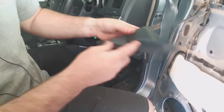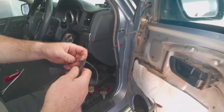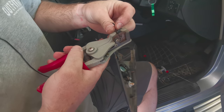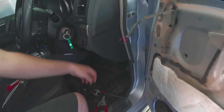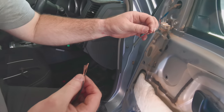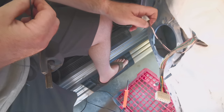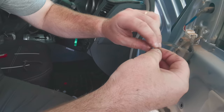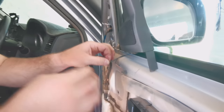So all you gotta do is just wire him straight in and that's your tweeter. So then we've just gotta cut him onto that and we'll splice him into there. So we'll trim this off about there. Hopefully I can, yep, that's good. Goodbye factory wire. So the one with the black stripe is negative, so it marries up to the negative one down here. So I've checked that with a multimeter. So we're gonna put our negative on here. Just sit him in there a little bit, so he can't go anywhere on me.